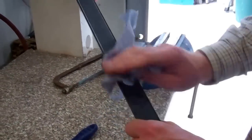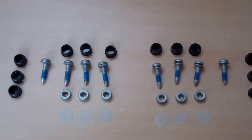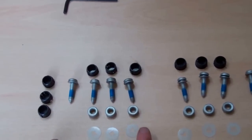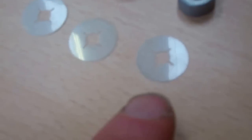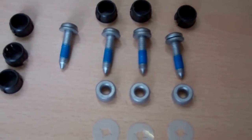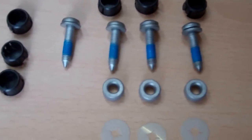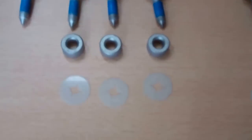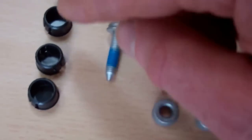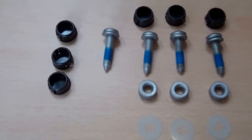Most of it is just these little bits of rubber. So now we've got a 19 millimetre hole in it and we're ready to go and put this back on the car. This is the fitting kit that comes with the kit — I've split it into two halves, one for the right hand bar and one for the left. We've got four threaded inserts in the roof revealed by taking out the filler strip, and that's what the four bolts are for. The three rear ones have a spacer, and to keep the spacer on you use this little keeping-on washer. Then there are blanks for the top, and three more to cover the other blanks.